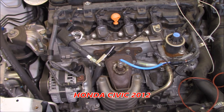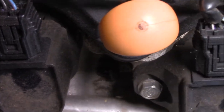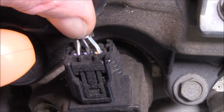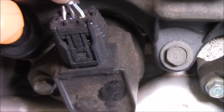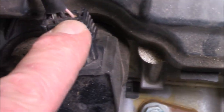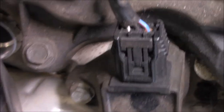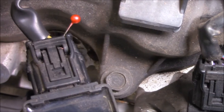Here's a quick method for testing three-wire ignition coils. I haven't looked at a wiring diagram — I don't believe I need to. If we look at all the coils, there's only one wire that's different on each coil. We have a black-white, a black, and a blue-red. Then a black-white, a black, and a white-blue. And finally a black-white, a black, and sort of a pinky-looking colour. So clearly those unique wires are our trigger wires, and they're the ones I'm going to trigger right now.